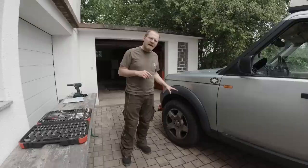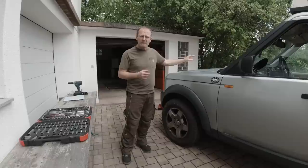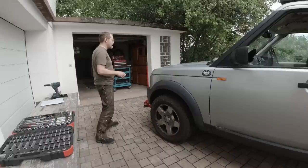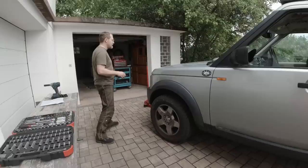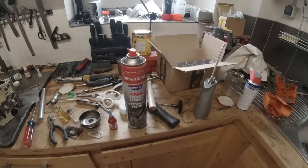What we've already done is a check if the car sinks down overnight. You bring it up into off-road height, then pull your fuse in the fuse box to disable the air suspension, let it sit overnight, and you can see what corner is actually sinking down. Our front driver's side corner — the front left corner for our British friends. When the front left corner sinks down, the front right corner also limps down a little because of the sway bar. That's pretty normal, but the one which sinks down further is most likely the problem.